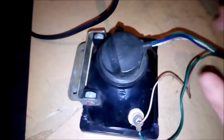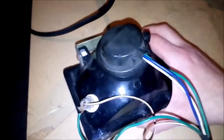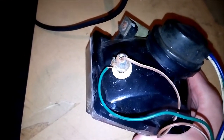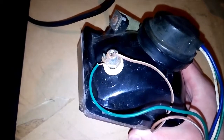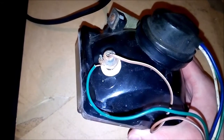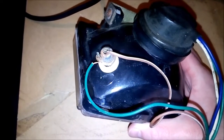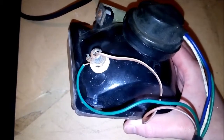When it comes to the headlight, we did test it — put a battery to the bike before we started taking things apart. Both of these bulbs do work that are in it at the moment, so we're not going to mess around with them. The only problem here is that the earth wire has snapped away — someone's tried twisting it around there. So what I'm going to do is just solder that in place, hard soldered on there, so we ain't got no worries. It's not really a clip that you can replace and crimp on, so it will have to be soldered on there.